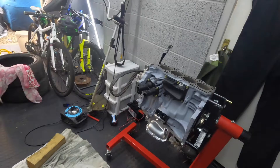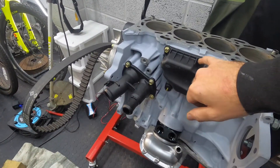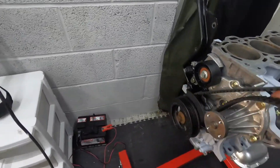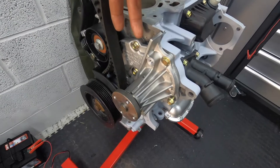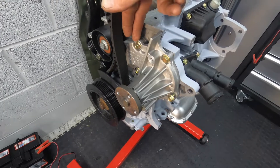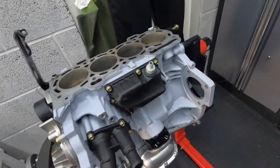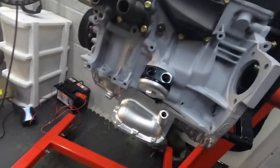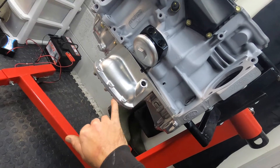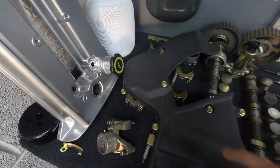The engine's back on the stand. I've just spent a bit of time going through - there was quite a mixture of bolts on here but I've gone through and made sure these are all correct. I've ordered a water pump gasket for 11 quid, the official Ford one, which should arrive in the post this week, then I'll torque it up to spec. The oil pan's on - as I said, I've messed up in the fact that two of the bolts I'm not going to be able to do until I remove it again. Also located all the bolts for the cover.